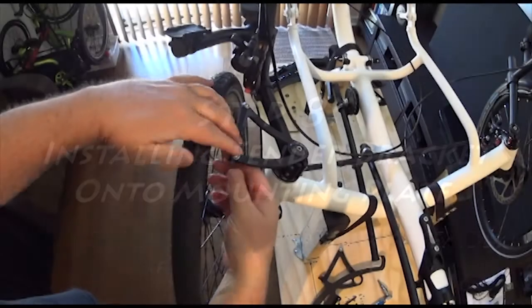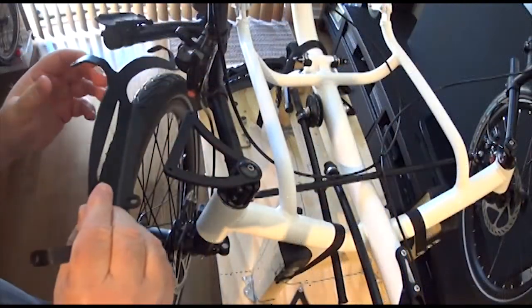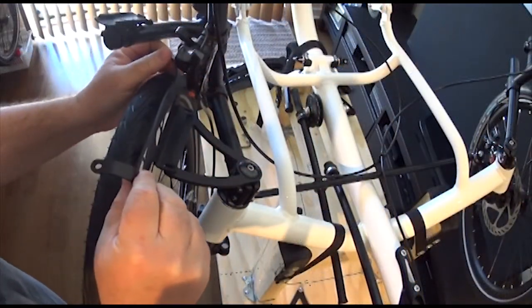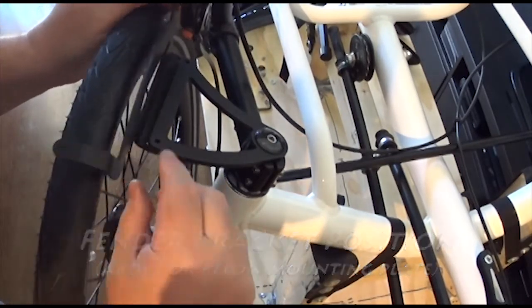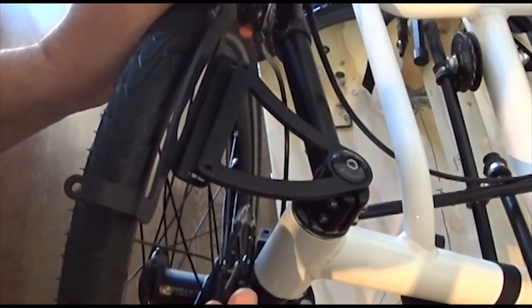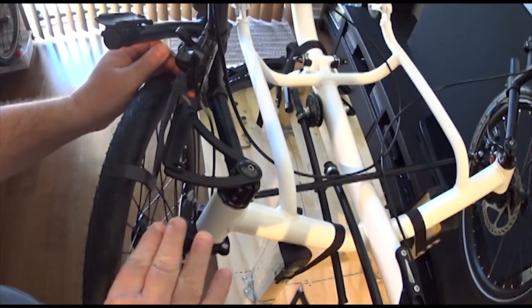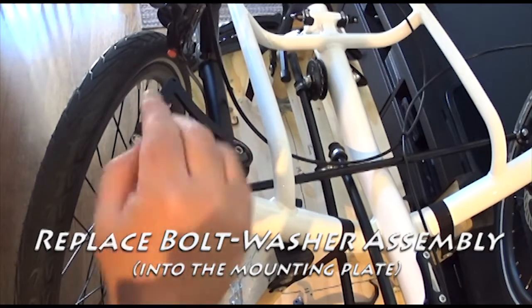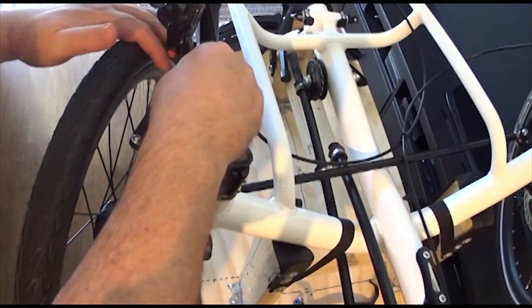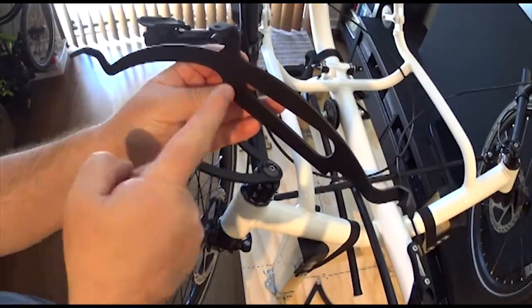It's now time to install the fender bracket onto the mounting plate. Remove the bolt assembly that are currently on the plate and place the fender bracket either on top or below the plate. Below gives you less distance between the fender and the tire, which is good for tires like a Durano or a Kojak, and the up high position is a little bit better for larger volume tires like a Big Apple. Since we are going to place the fenders in the lower position we are going to place our bolt and washer assembly into the mounting plate. If mounting in the upper position you would place the bolt assembly onto the fender bracket itself.